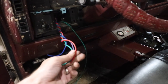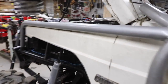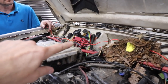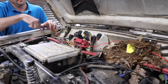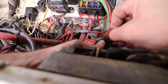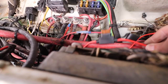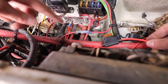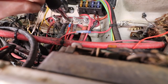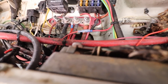Now we need to find a hot for that one positive wire. You could go to your fuse box or wherever you can find a hot. In this case I have a hot block right there — that red block. We're adding a fusible link and putting a small fuse in there; this one's five amp but you can go as small as two amp since it's a very low-amperage circuit. That hot source could be a relay box, fuse box, battery, or you could even pull the 12-volt supply off the winch itself.